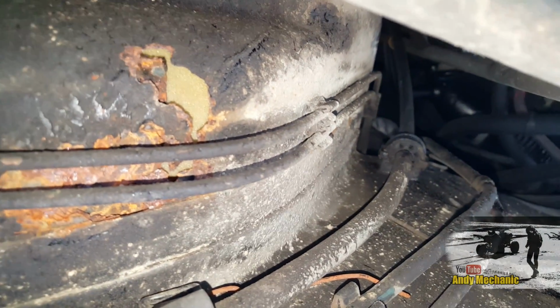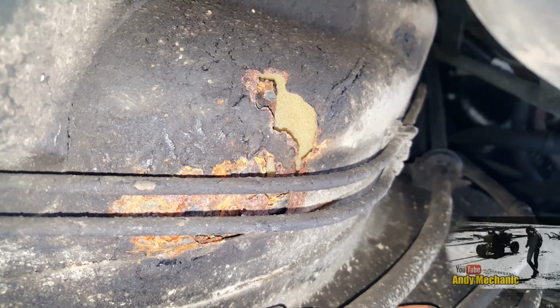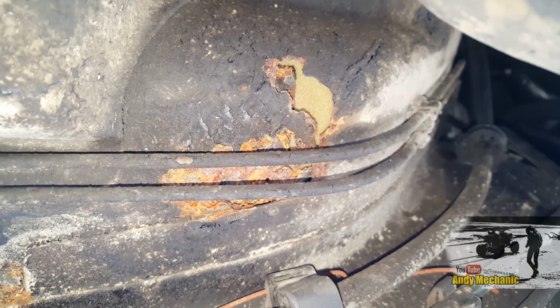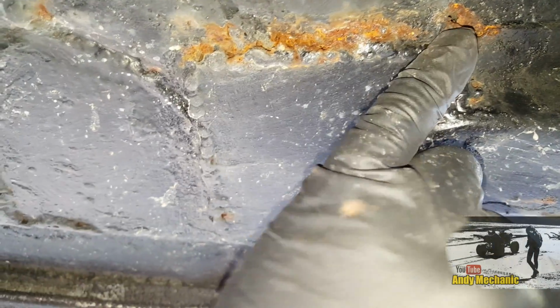Okay, so underneath, we had a quick look around earlier on, and that's the major hole there, look, we've got that to fix. Now, these two pipes here, these are unfortunately just brake lines. So we're not too concerned about those, brakes aren't that important, but down here, this is a fuel line. So I've got to release these clips and try and get that as far away from the ignition source of the MIG as possible, because there's going to be quite a bit of heat generated when I come to replace that bit of floor pan. Now, unfortunately, it's getting a little bit crispy. There's a few other really minor areas, especially a bit further down. I've got one here, look, you can see there's a hole just in there, and another one there. And there's a few bits really where, well, the welding's just sort of hanging in there, to be honest.